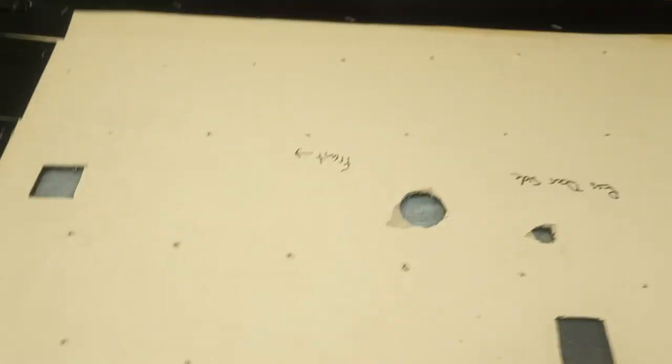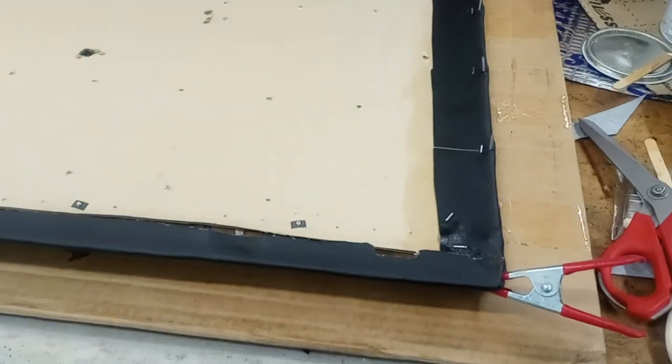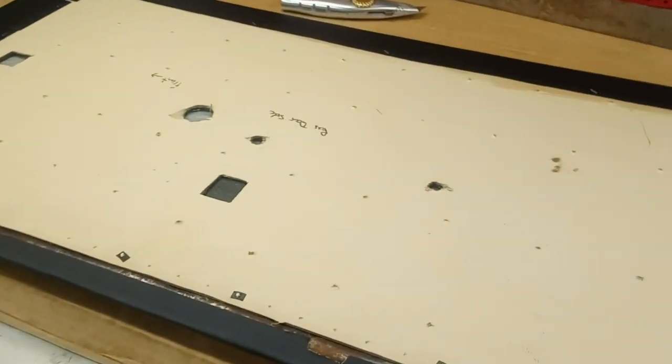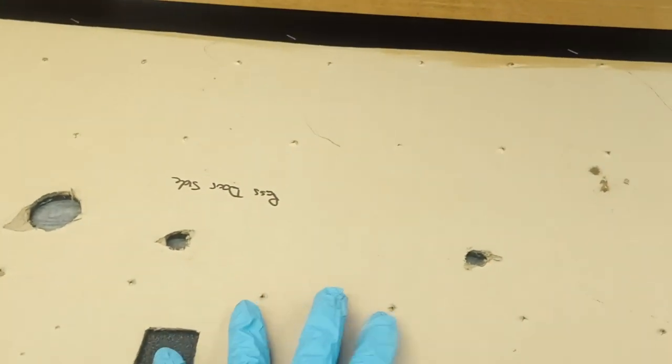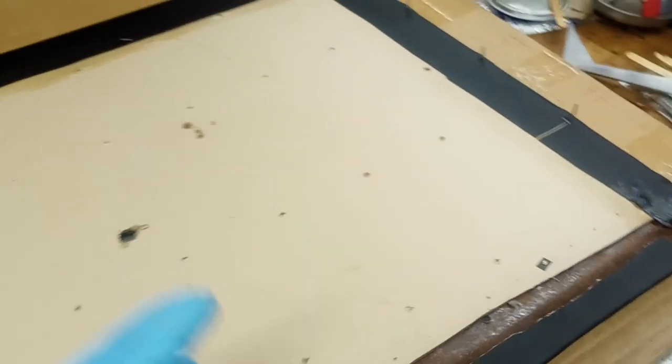What I like to do is turn it back over. Those nails make it a little cumbersome to work with but they're not too bad. I like to put something on here just to weigh it down a little bit, just to hold everything in place, and then just let it set and dry — I think they tell you to let it cure for a day or so. So, first time doing a door panel restore. If you're a good DIYer you could probably do it yourself — find some directions, watch some videos. I got a good result. Next step is I've got to put the trim on, poke some holes through for the trim nails that go through and bend down. More to come, thank you everyone.